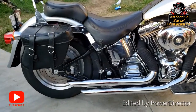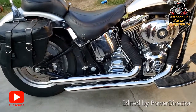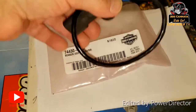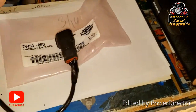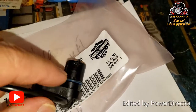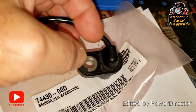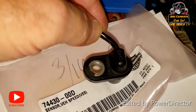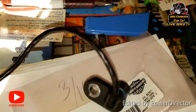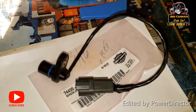I have my Harley-Davidson sitting out here on the driveway to show you just how easy you could fix this on the side of the road or sitting in the parking lot of a dealership. This is your VSS unit you'll get from the Harley-Davidson dealer. This is what it looks like — it goes down into the transmission like a little cork. You'll take your bolt off the top of the transmission with an Allen wrench, put it down and tighten it into the transmission. The wire threads back behind the battery and up to a plug. This part cost me $71.